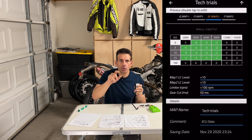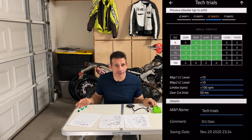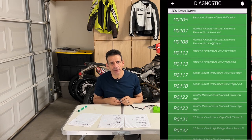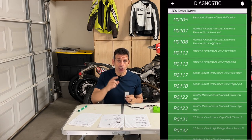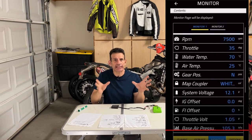In each map you have the ability to make different adjustments to your fueling. If you think about the Vortex, you have low, medium, and high adjustment with 10 settings. In this one you have settings for every single piece of the RPM range, for every quarter turn of the throttle. Whatever your imagination can dream up — which most of us are never going to walk down that road — you can adjust it with this ECU. The app also has diagnostics: if you think you're having a problem and the check engine light is on, it shows the codes right on your phone.